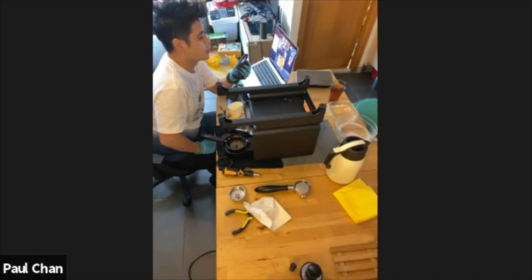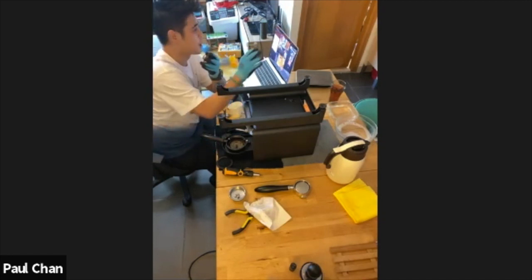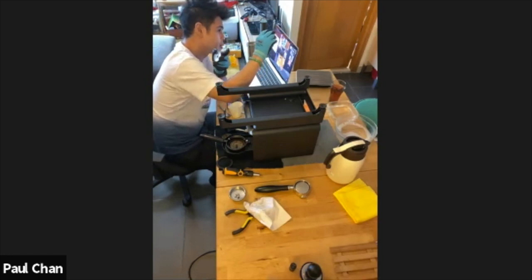Otherwise, you can try and keep on top of it with the blind flush, but as we have mentioned, it does not clean the upper brass parts like this one here, which you can see is a little bit dirty, but most of it is the tarnishing, and it's not too bad because it's only been a week and a half. But let's say 200 coffees came through this brass plate, it would be a lot darker and a lot oilier.